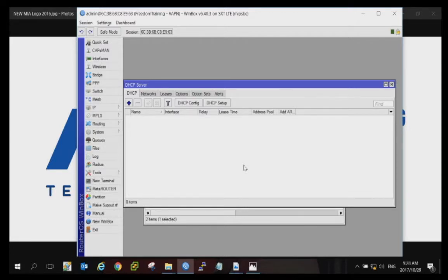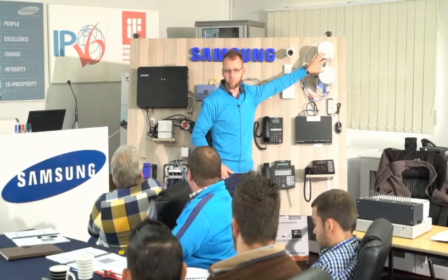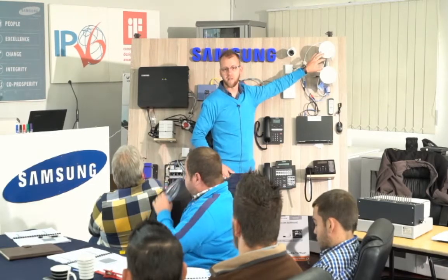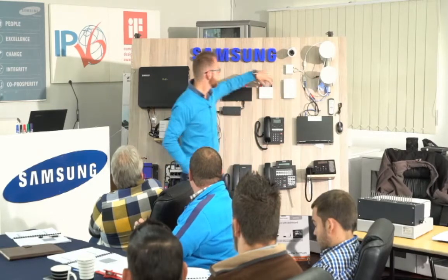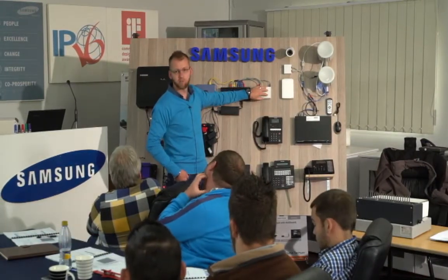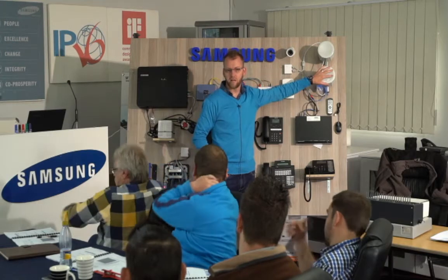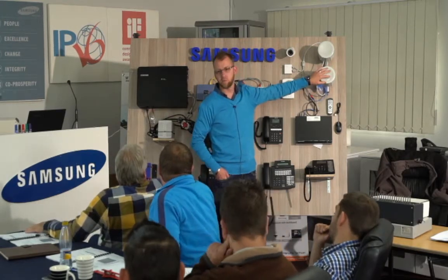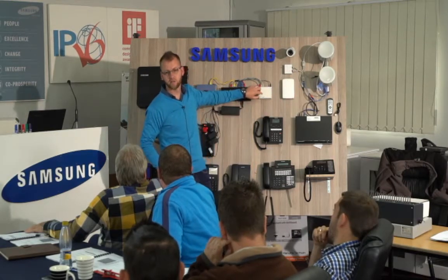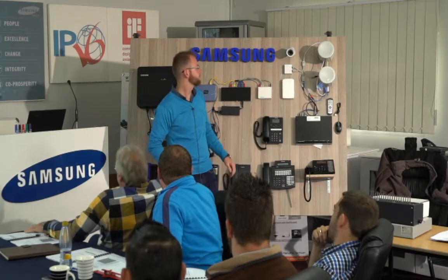Yes. Okay, so if you guys can turn this way. We've got our two LTE routers here. This can be MikroTik, Billion routers, Huawei routers, any router that we use here. They will not be giving out DHCP. They'll have a static IP address only. The RB750 is the one that will be giving out DHCP. Okay. And this will be the gateway of all the devices, not this. If it's a standalone device, the LTE router will be giving out DHCP. And that will be the gateway of all the devices. On a failover, it's this one. Okay. We're going to have DHCP running over here and here, and it's just going to mess things up. Okay. So that's why there's no DHCP configured on this one.